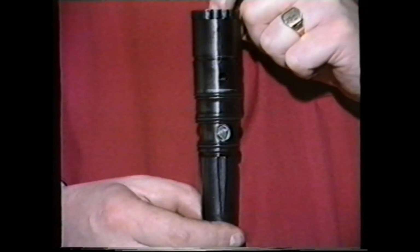Before refitting the injectors to the engine, replace these 3 O-rings. Failure of these seals would create the following problems. The upper seal will allow fuel from the return to leak into the engine and contaminate the engine oil.